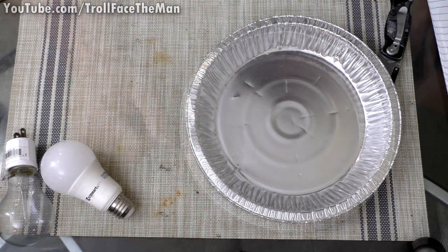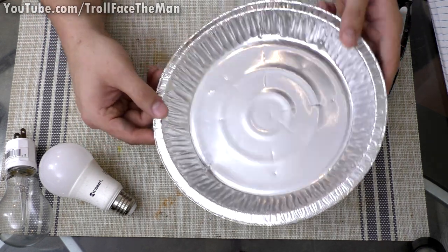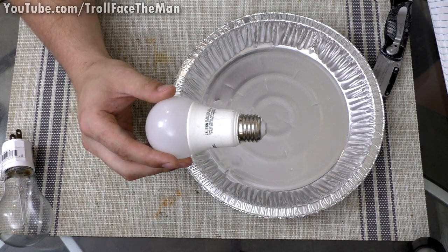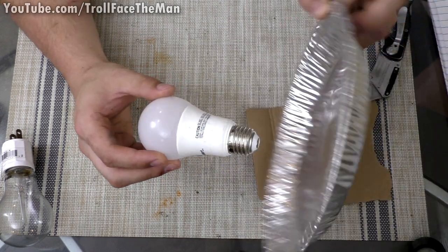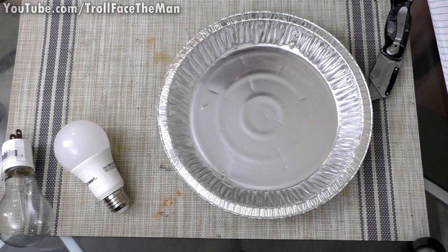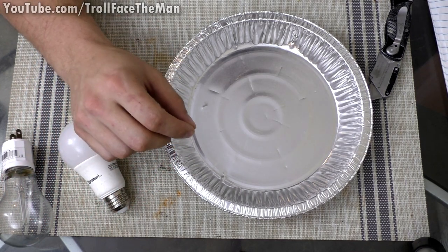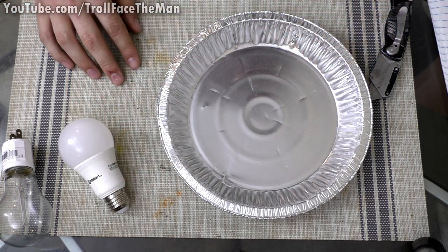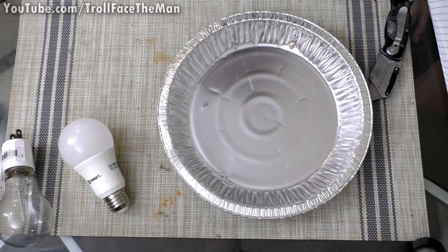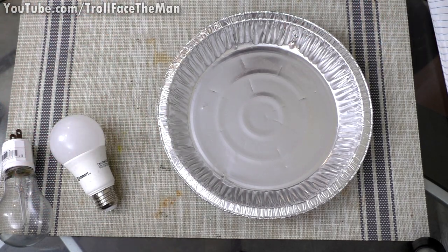So just as a heads up, it's going to be a very interesting video. The first and biggest challenge of this is making this fit onto a bulb. The obvious thing might be to just cut a hole and stick the bulb in, but if it's just a loose hole this reflector is going to move around and not want to stay on. I was thinking how could I make this where it will hold into place and you can adjust it a little bit? And I thought - straws, more specifically how straws go into the top of plastic cup lids where they have those slits. I was figuring if I made little slits in here to have sort of fingers to grab onto and bend, not only would they bite on and hold the reflector onto the bulb, it will give me a certain amount of adjustment. And that's precisely what I did.